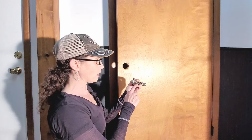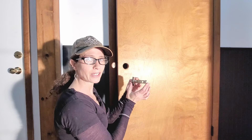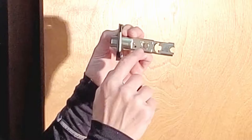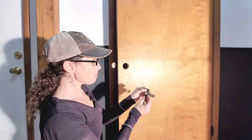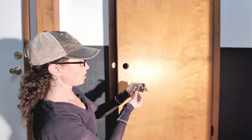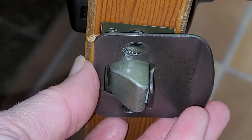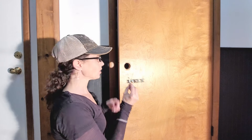There's also a built-in feature that lets you adjust how long this is in case it doesn't fit into your space. I'd suggest putting it in there first and seeing if it fits as is, so you don't have to play with the adjustment. But it's located right here — there's a little lever you press down, and then you can slide this back and forth to accommodate your opening. Make sure when you do the orientation that this flat side goes to the flat side here on this plate. So when they get inserted, just make sure your orientation is right.